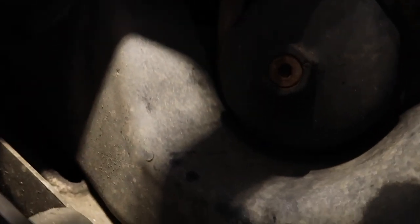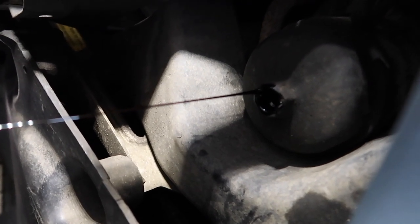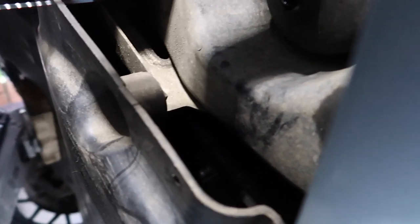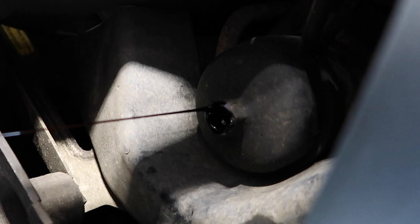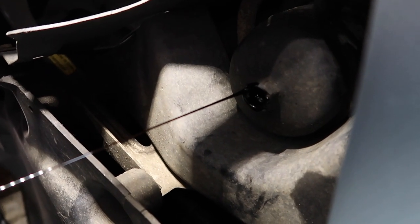Here's the oil filter housing, and as you'll see there's the drain plug. We're going to release that and drain it. We've now released the bleed screw and the oil is draining down. It's the 6mm allen key bolt to release that and let the oil filter housing drain. Then you want to get your 24mm socket and release the oil filter housing cap up here, which we'll be doing to take the oil filter down and replace it.